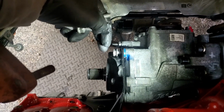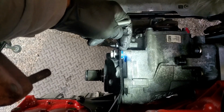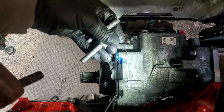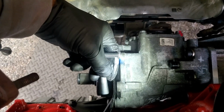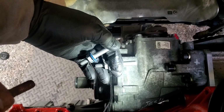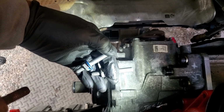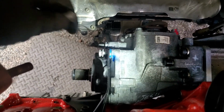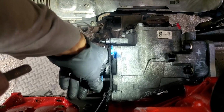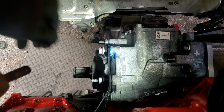Why would you have one side of the bracket, whether they lost the washer or not? Either way, if I put a washer here, we upgrade the bolts to 12.9 just to keep everything consistent, as well as we don't want a bolt shearing off in the transmission case. Either way, we put stronger bolts in here. Our bolts will bolt in to the factory locations, and I stick the washer in between, and everything will mount up perfectly.